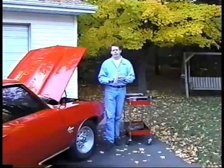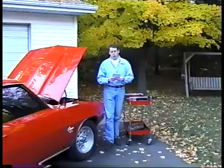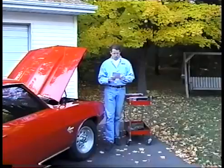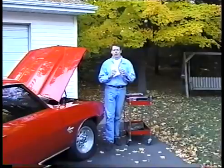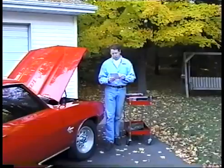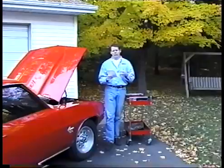Let's look at what this video is going to cover. First, we're going to look at tools and supplies you're going to need — from different spark plug inspection lights to hand tools that can be helpful and protective gear. Next, we're going to look at how to properly remove spark plugs, and believe me, there is a right and wrong way to do that. Then we're going to get into the reading. First, we'll look at common mistakes people make, which usually involves trying to read a spark plug with automotive type charts. Next, we'll look at how to get good spark plug reads and how to get a good baseline read for your spark plugs — on the dyno or at the racetrack.